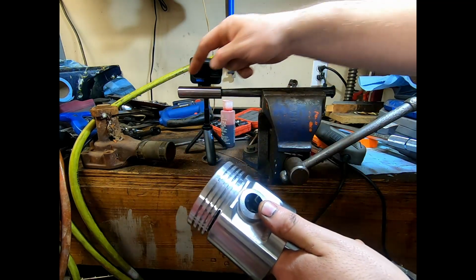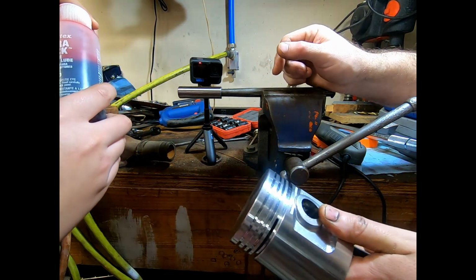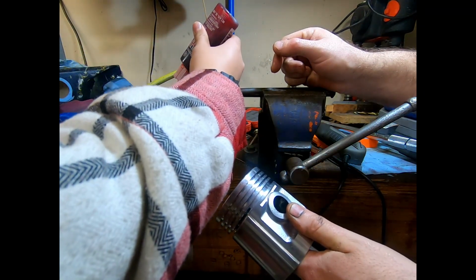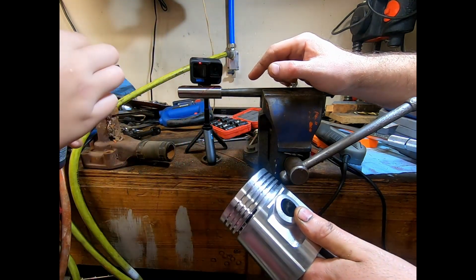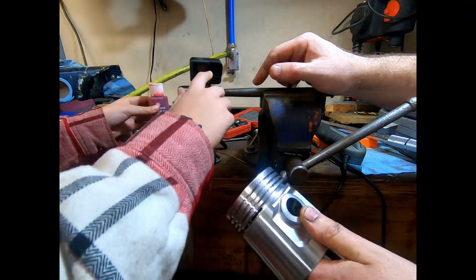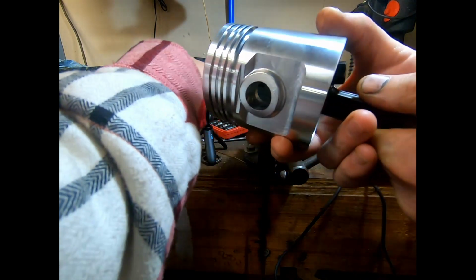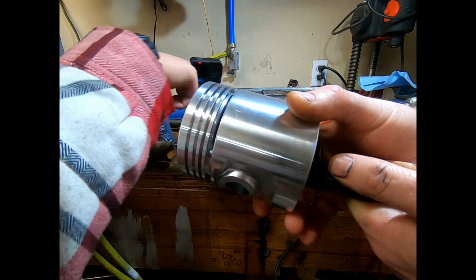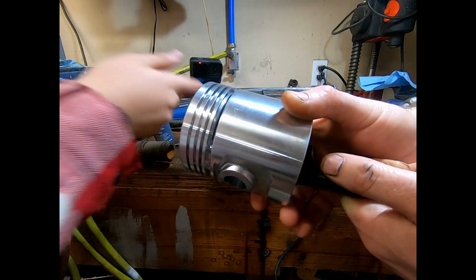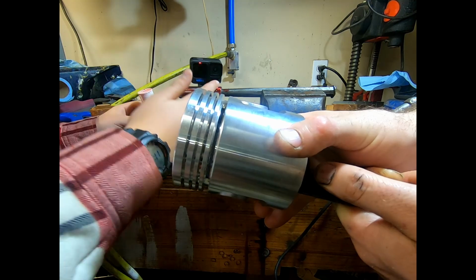So what I want you to do now is take a strip of assembly lube and put it on the pin right here. Okay. Good. Kind of smear that all over, all around. Take some and put it in each of the holes. Here, check. Wipe some of that off. Fill it, yeah, smear it in each of the holes. Get more, get plenty. There you go. Good deal.